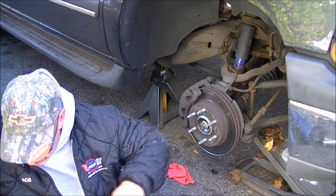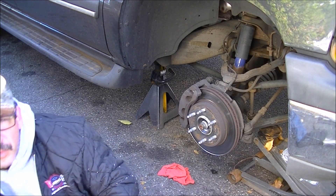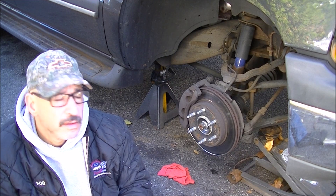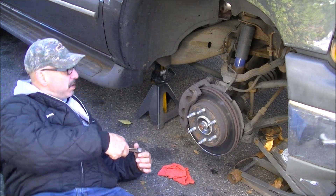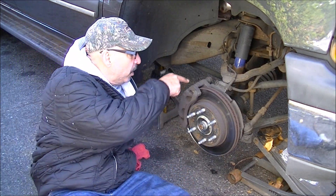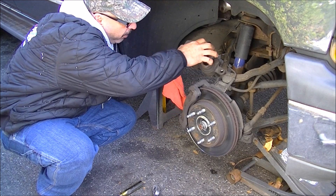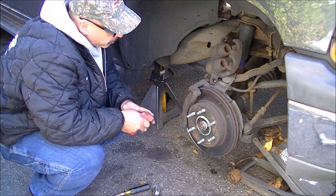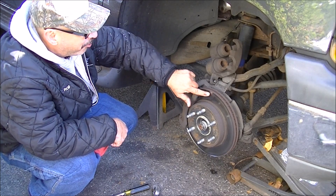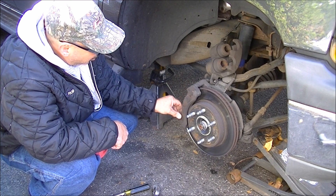There's no reason for them to be in that tight. The last brake job on this vehicle was done on the road while we were on vacation, and we got it done at a Firestone. So with your two caliper bolts out, use a little screwdriver and you should be able to pry that caliper right out of the bracket. It'll come out over the ridge. You can see how far out those pistons are. My wife said the brakes were starting to make noise — and you can see how grooved the rotor is.